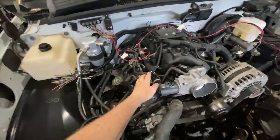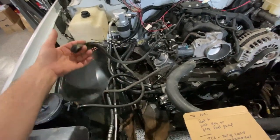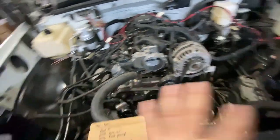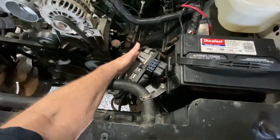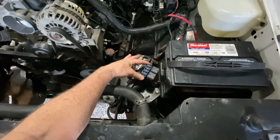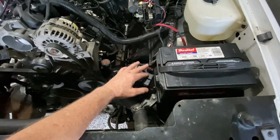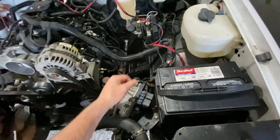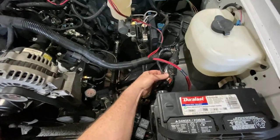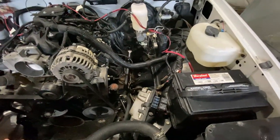Everything else was simply a connection on the motor, and the only one that's not connected at the moment is my MAF, which goes with my cold air intake that I have yet to install. Everything else was simply a matter of connecting to the component that was still here. Over on this side, I mounted my PCM down here below the battery, my relay that I made with the four 15-amp fuses and the dual relays — main relay and the other relay for the fuel pump — based off of lt1swap.com, is right here. The rest of the wiring I need to just finish up, tape it, and make it look a little better, but in general it's all there and functional at this point.